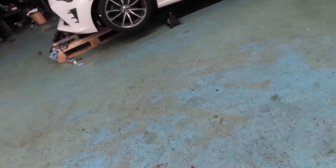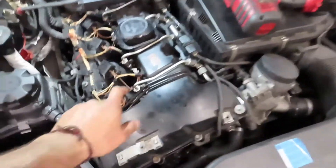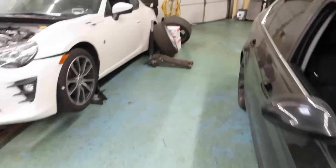I just got to the shop and I'm getting a battery pack to jump my car. I'm going to pull it in and do the injectors. I also have a VANOS code. First thing is to unplug the battery so no extra fuel starts flowing when I disconnect the fuel rails for the injectors.